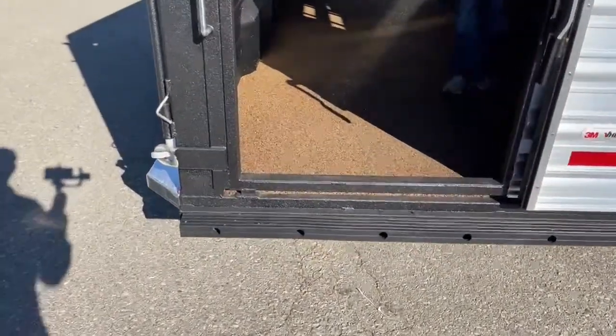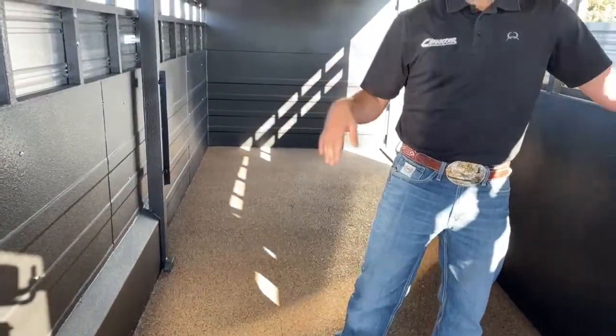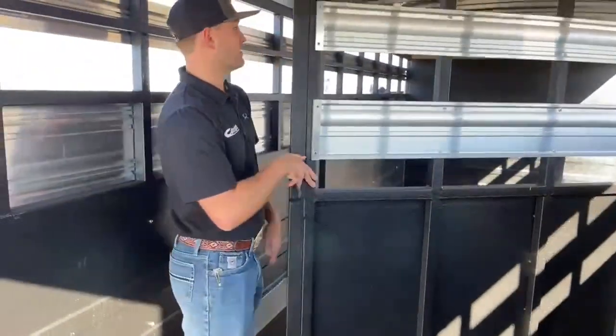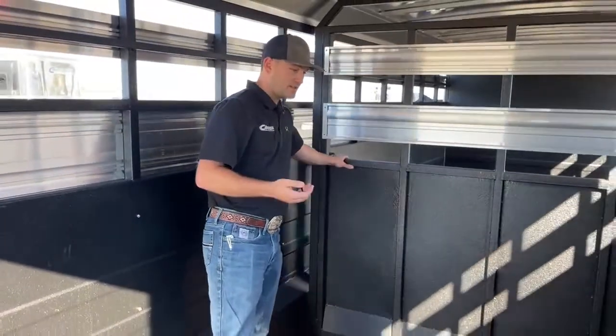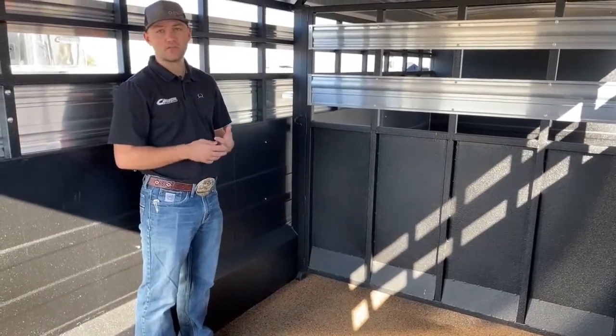On these stock combos we do Logan's polylast flooring. The cool thing about this flooring is it's a self-draining rubber — it is porous, so urine, water, anything like that is going to go straight through it and run to the road underneath. The rubber sits on a vortex-lined aluminum floor that has slats cut in it, specifically designed to drain out of this trailer. It's going to keep this trailer smelling and looking really fresh while you're traveling. This center gate is at about 10 feet, giving you about 20 feet of stock area — it's a 26-foot combo with about a 6-foot front tack, so you get about 20 feet of stock area back here.